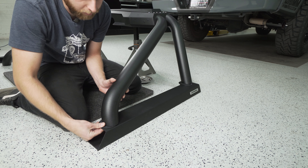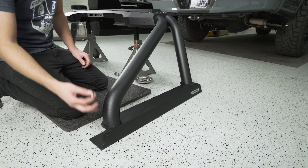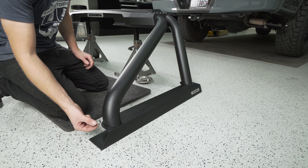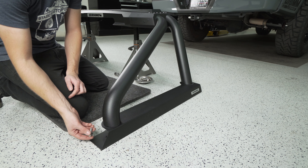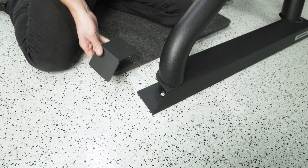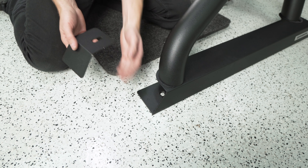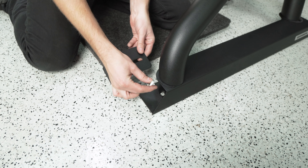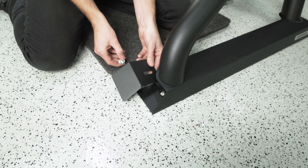Once you're done, you should have your bars kind of in place — the bottom should sit in a straight line and then make a triangle shape once they're on there. Now we've got the bracket for the bottom that's going to attach to the vehicle, and we have two more plastic caps that are going to go in between to reduce vibration and clean up those gaps. You'll see at the bottom of your bracket there's usually a P or a D for passenger or driver side, so just make sure you get all that lined up the way it's supposed to be.